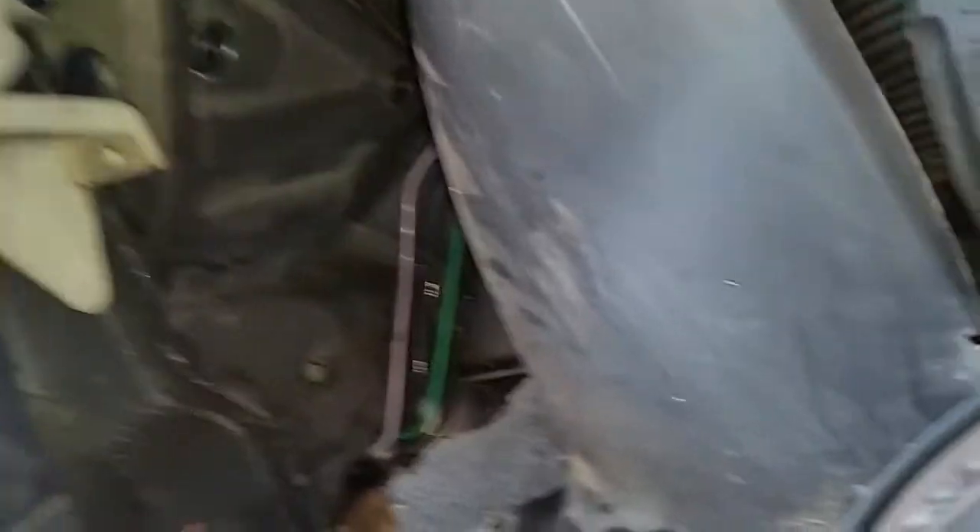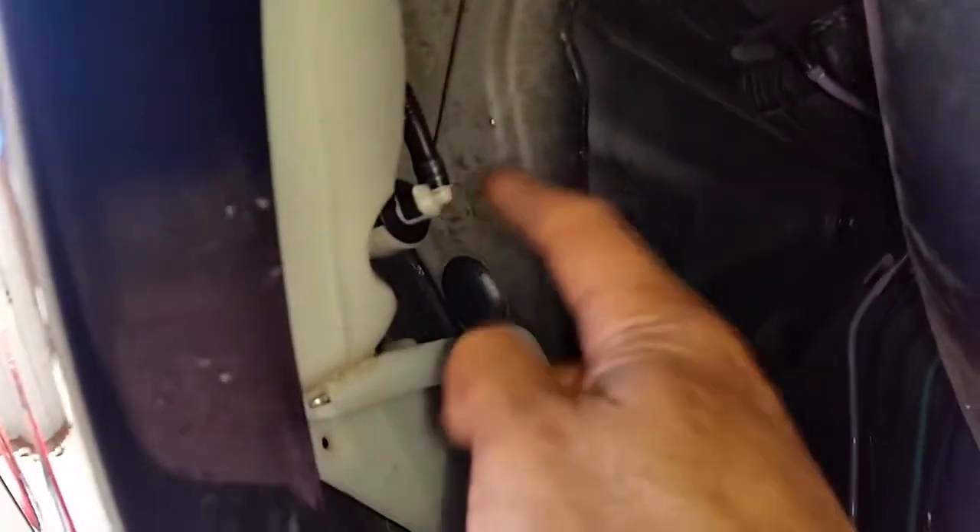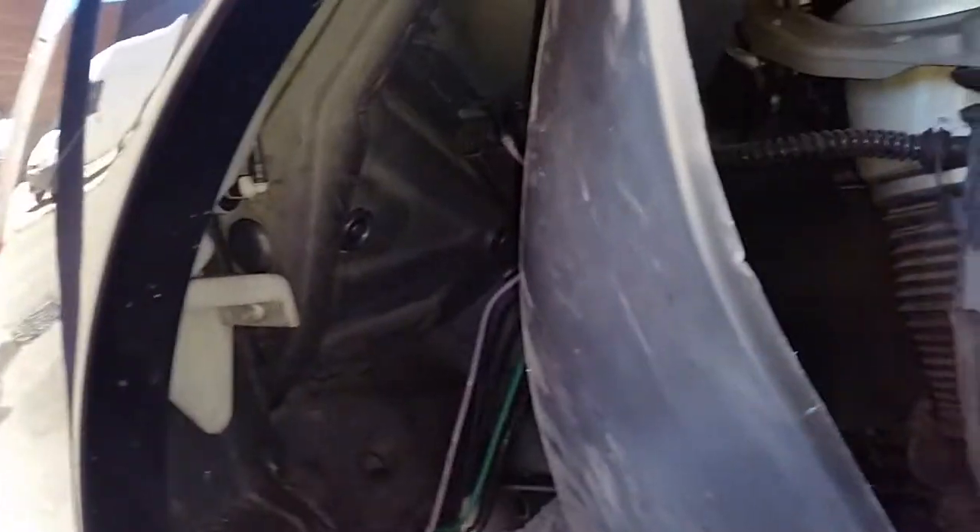So what I've done: I've checked the wiring, I've checked the power at the fuse, and I've checked the power at the actual pump — it's all good. But I've found that the little motor sits here. That's your washer bottle there, and that's the little motor there. It's a bit of a pain to get to, so you've got to remove the wheel and remove the rear part of the wheel arch.